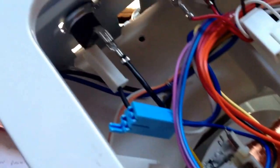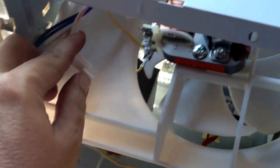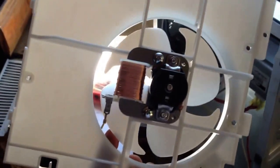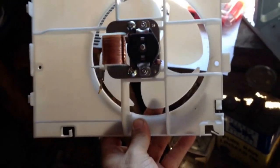We've taken out the mounting screws, so we're ready to remove the cooling fan mechanism. Take the wires out of their clip, unplug it, and just work it free. That is the cooling fan assembly for our microwave.